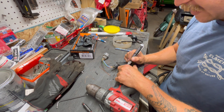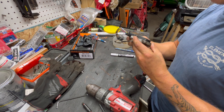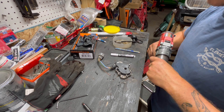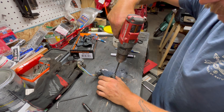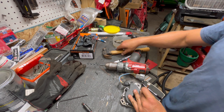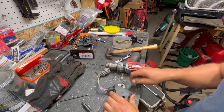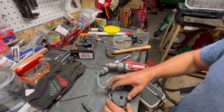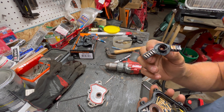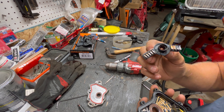A regular ratchet works here. That middle bolt does have to come off — that's a 13. Then you gotta pull the gear shift back, make sure your stuff's blocked so it doesn't roll over you, and then work this little lever off. It's seized on there. What I did was push it really hard up against this and then push it up, bending the top and pushing it up against that, and it'll scrape free. It's super tight.